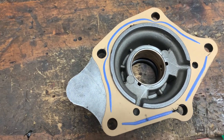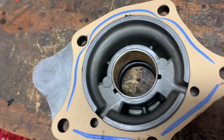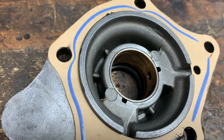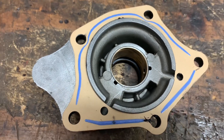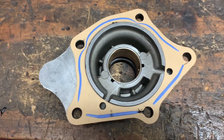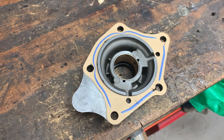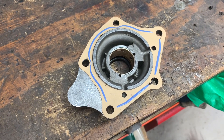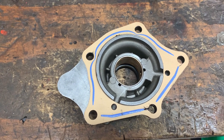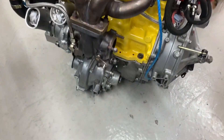Right, one of the last little things to do before the engine goes back in is refitting this driveshaft output cover, which has now got a new bronze bushing which I've had to ream — took me over an hour because I didn't exactly have the right item for reaming it, but I made do and it's now a beautiful fit onto the pot joint. There's no movement at all, it spins freely on the joint but there's no play. New gasket, new seal — that's a genuine gasket. So I'll get that bolted on and then we'll have two pot joints with no play.